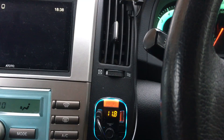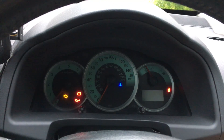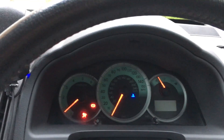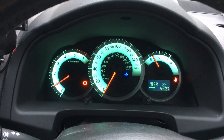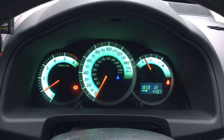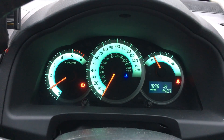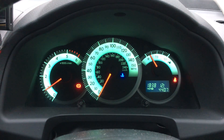Making sure the lights go out and voltage is all okay. Starting again we should see — yeah, high voltage, 11.8 volts — that all seems to be good. Right, let's get this thing started. Well, that wasn't great. We're going to stop that again. There we go — only just got it going, doesn't seem very happy. Now I'm going to leave it idle with my foot on the foot brake for five minutes. This should allow all of the ECUs to basically reassess the situation. We have a smooth idle so far, but it may not remain smooth — it may start jumping around whilst it's trying to reset things like throttle positions and fuel trims, and it could even stall.